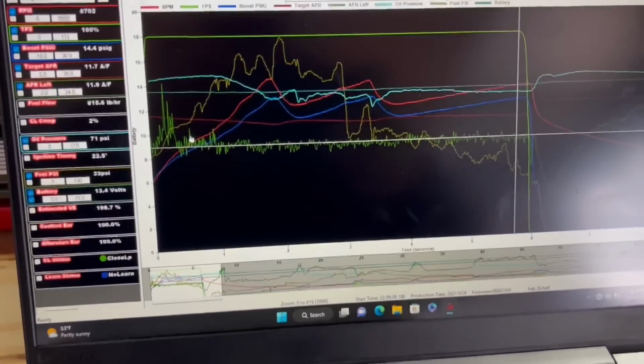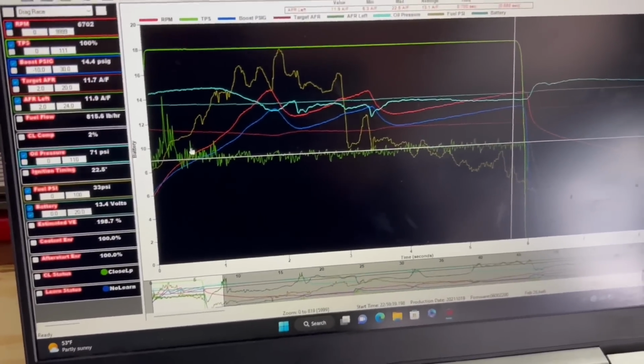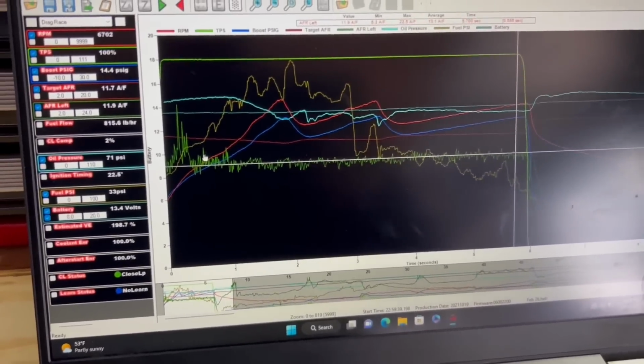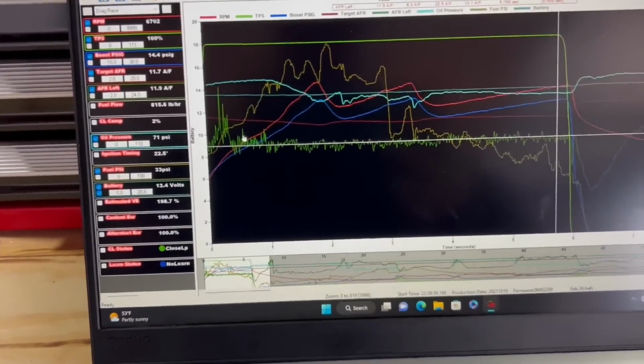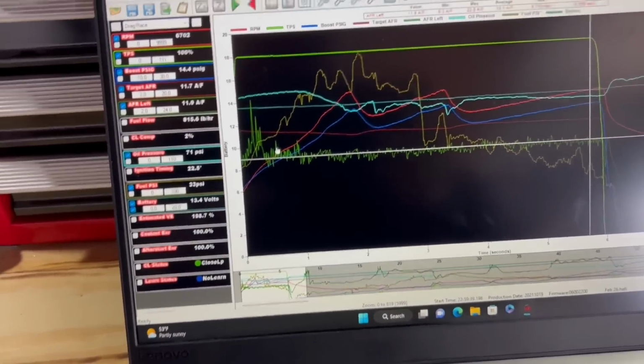15 gallons. So he's got a 15-gallon fuel tank. He's got a Magna Fuel 750 inline that is external off of a sump. And then he's got an internal, is it an A1000? A1000. So it's an internal A1000, and they Y together, and that way we have plenty of fuel flow, right?